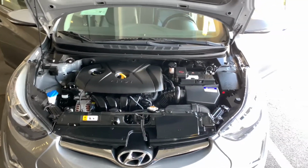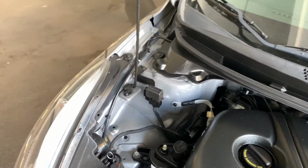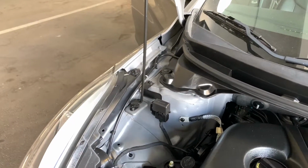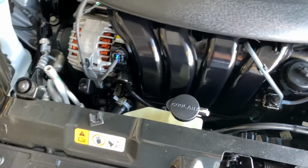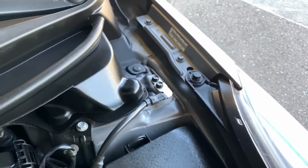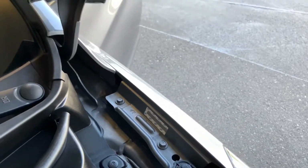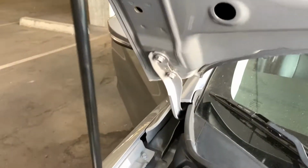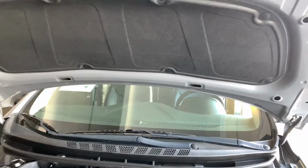But to start off, I usually start with my front right apron, and I make my way over to the left one. Here we're looking at the spot welds, any turned bolts, the baffle, your front right rail, your left front rail, your left baffle and apron, strut tower, checking for any turned bolts along the sides, including your hood, because you never know where all the damage is at. Checking that there's no scraped paint off those bolts, because usually the factory keeps them fairly straight.